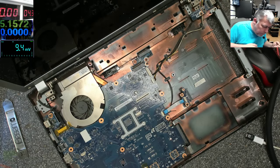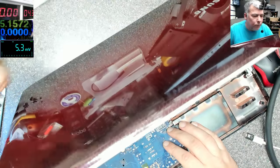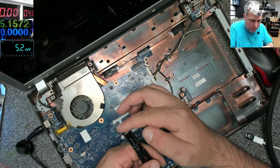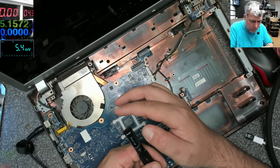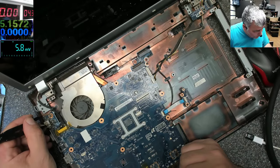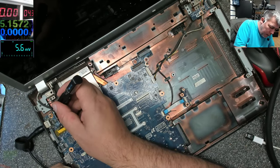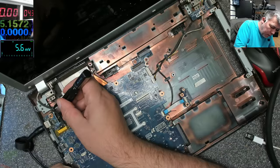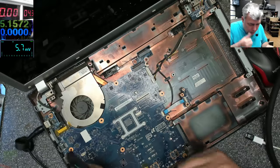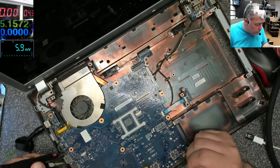But I have a bad feeling about that charging port. Multimeter. So, multimeter, volts. And we have ground, and we have these carbon resistors, and we have, what do we have? Nothing. We have no voltage. 0 volts. This is just a charging port job.